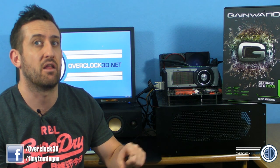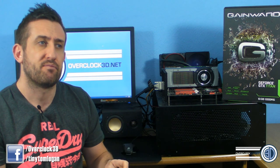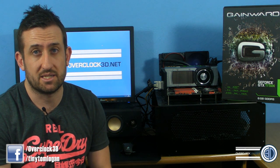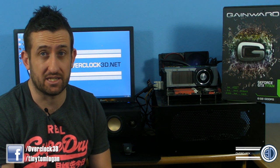After the 480, NVIDIA learned their lesson with how hot, and how loud, that card was, and they've really upped their ante. There's an extended fin stack, and the fan can be controlled by both voltage and RPM to maintain optimum fan speeds. We'll talk about it later, but it's so quiet, it's unreal. A lot of people will say, oh yeah, but it gets really warm. But these things are designed to run at 80, 90 and upwards and still remain safe. I would much rather my GPU on air be running at about 80 degrees and quiet than running at 70 degrees and me being able to hear that fan spinning up. This thing is ridiculously quiet.